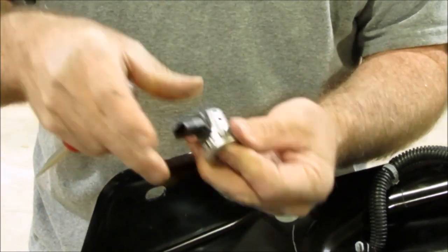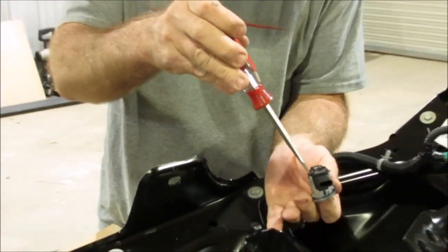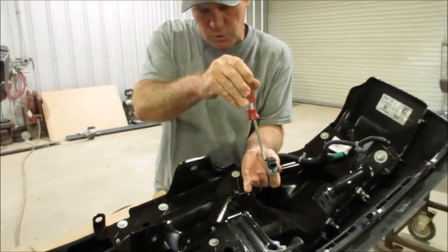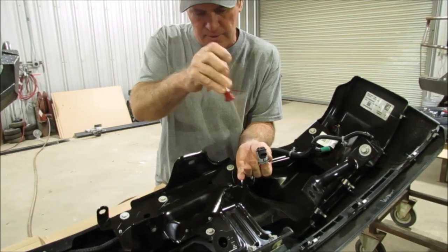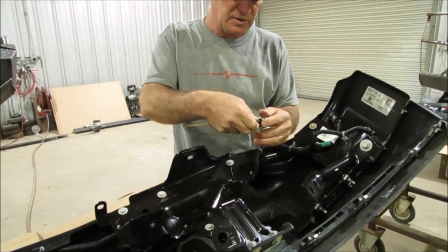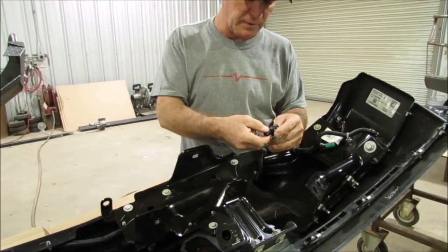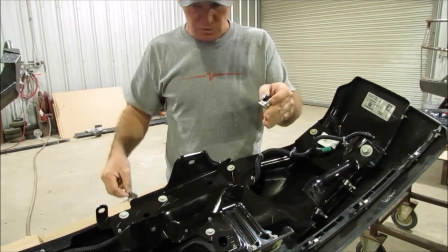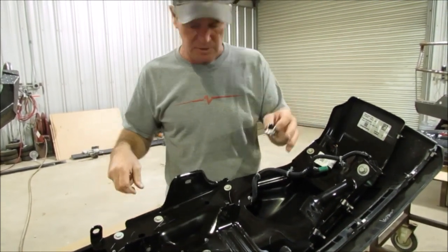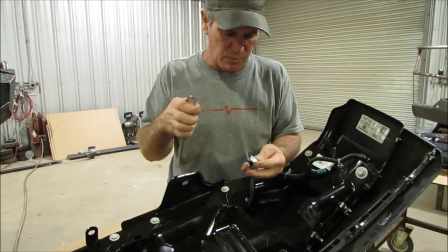So when it's pressed down in there, you'll pull it apart, and you kind of push one out, and then you go over there and just pull it. You turn the screwdriver and it pries it out like that, and then that sensor is going to pop out of there. You have a little harness that just unplugs on there, same little red clip. You pull the red clip back, push it down, and it just pulls straight off of there. This little sensor housing, sorry, comes out of the bumper. You're going to put that back into your front end replacement.